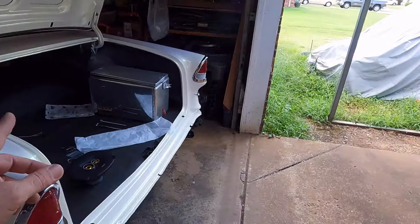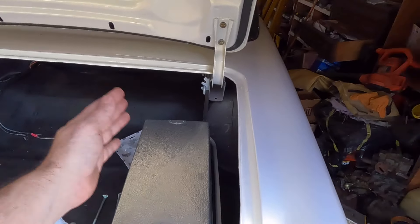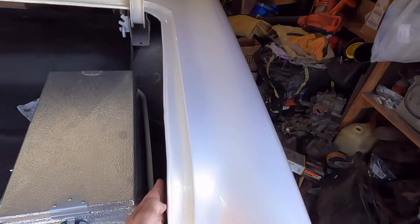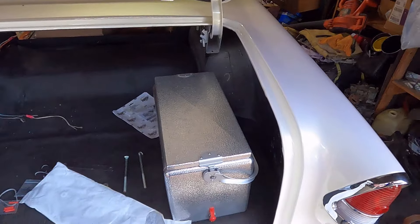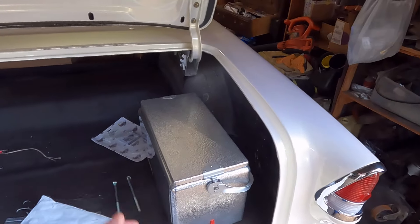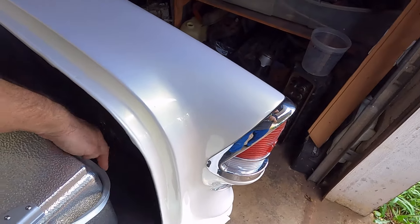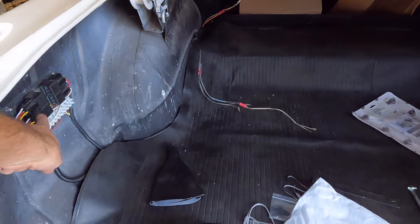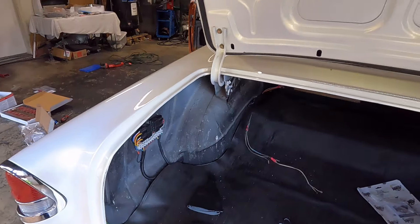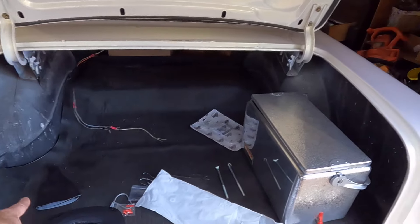He said he thought he'd do the trunk like mine, so that's why the battery box is positioned where it is — I'd already asked him about it. He wants to upholster the trunk like my car, so there's going to be a wall right through there. I spaced it out enough to have clearance for that. Someone mentioned why I didn't stuff it back further — that's the reason. When the wall goes in it'll clear the handle, and the walls will hide all the electric gas door hardware and the mini-tub work.